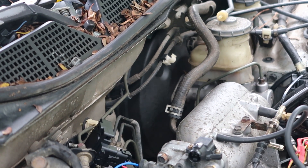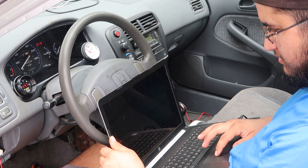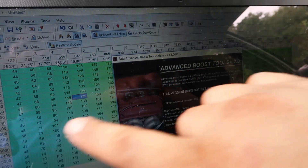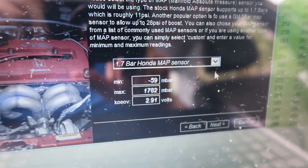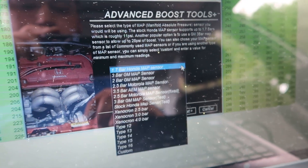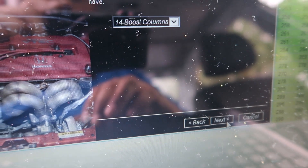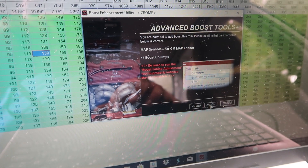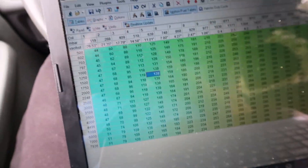Now I need to get into Chrome and do the GM three bar conversion. If you go to plugins, then Advanced Boost Tools, right now I'm running the stock Honda 1.7 bar MAP. Just go through the wizard — next, next — and right here it gives you the options. You can see the 1.7 bar stock Honda MAP sensor. I'm going to scroll down to the GM three bar and select that one. Next — 14 boost columns, so you get the most columns in the boost and you can tune more tables accurately. Next, next. Now it goes all the way to 30.2 PSI, versus I think it went up to like 11 before. So I get this whole extra range to tune with — easy as that.